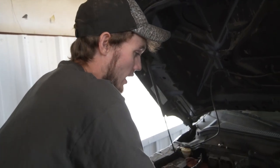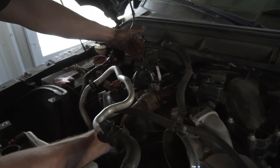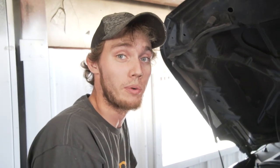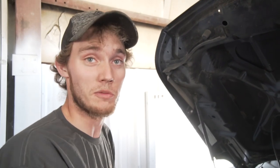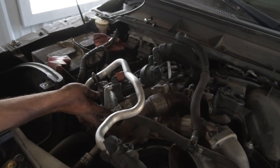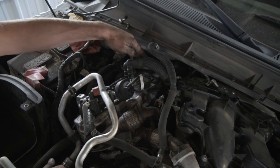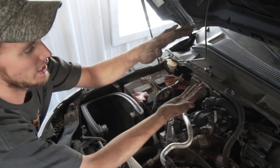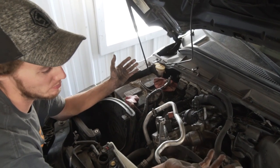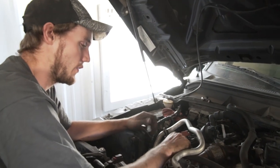From there it has you start removing the EGR. The EGR — exhaust gas recirculation — is put on diesels to help control emissions and is probably the first thing that gets deleted on any truck that has it. Cummins, Power Stroke, Duramax — they all have it, they all get deleted. This EGR unit is a big thing — it goes underneath the firewall a little bit and back around. It uses antifreeze to help cool the gas being recirculated.